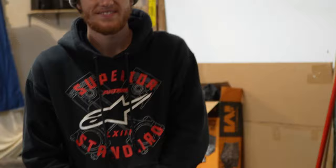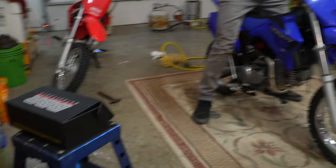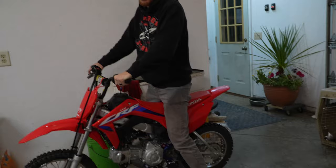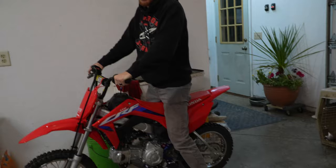Yamaha's got all their little tricks. But all in all, it turned out well — looked sweet. One problem with mine though: the shock is bottoming out and clapped, pretty much. I don't know what the deal is — I weigh like 185 pounds and this is supposedly for a 250-pound person. It's supposed to be the same shock as Jack's, but his, you sit on it and it barely moves — stiff as a rock. Mine sags way down. We'll have to figure that thing out.